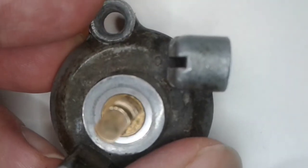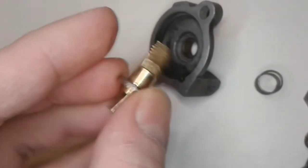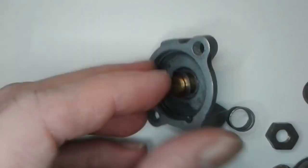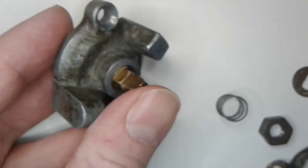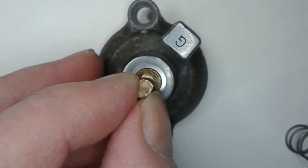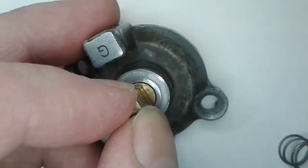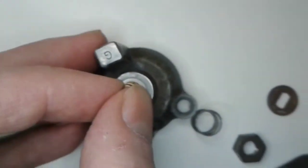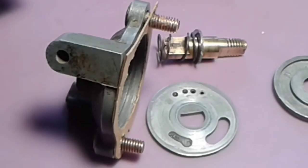Certainly we are not going to buy a new Coldstart device. Therefore we need to grind the surface of the shaft and make a bushing of a smaller diameter for it. We'd better do this than have the pain of searching for new spare parts. I think we can use the help of a turner. I think this gasket wouldn't hurt.